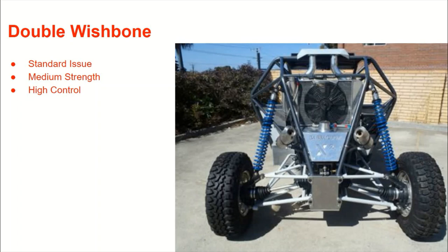One of the downsides though is if you're on rougher terrain, really rocky and nasty terrain like where we're at, they're not going to be as strong as some other setups and it's just not quite going to be the best option. Another key thing is you're not going to have to worry too much about CV axle plunge. As you can see here on this setup, the pivot points go through where the CV axle joints are at, so you're not going to have to worry about your CV axle binding. It's pretty much the run-of-the-mill setup that everyone's going to be using — you can't really go wrong with it.